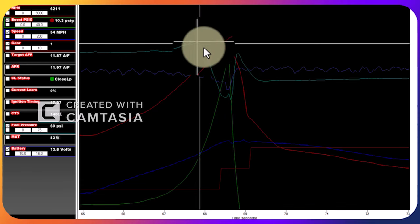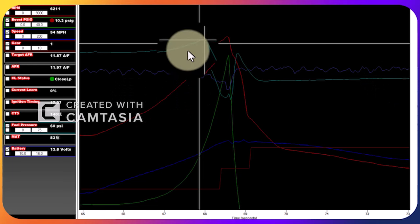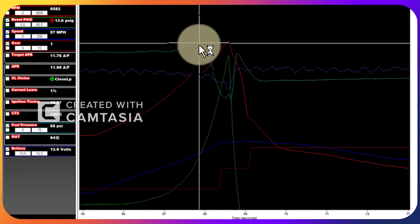So our next pass would have been to run this on just wastegate, no dome pressure. And the reason why is because we have two wastegates, one for each side of the engine's exhaust banks. So you have two banks. If you have an 8-pound spring in one side and an 8-pound spring in the other side, that's 16 pounds of positive pressure you need to create for them to start opening. When you add 10 psi of dome pressure split between both of those, now you're adding an extra 20 psi on top of that, because 10 each.